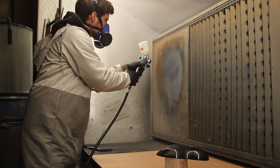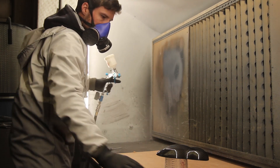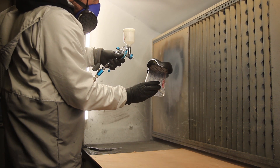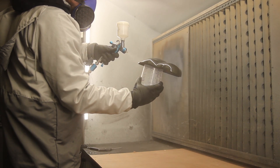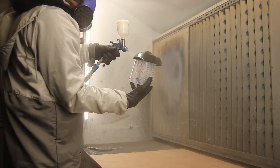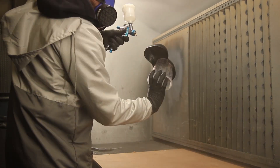The heavy first coat helps fill the little sanded areas and any pinholes still remaining after the q-tip filling. Now we go with a second coat — I applied two coats here, sometimes three is needed. This second coat is thicker because the first coat is already on, so you get less chance of runs and a better chemical bond between the layers.